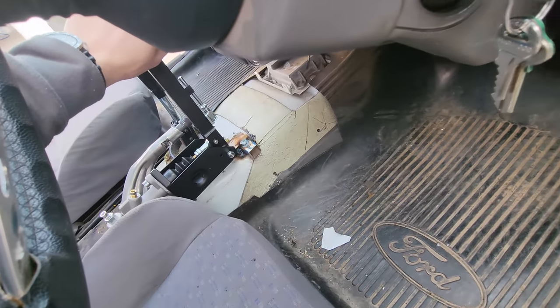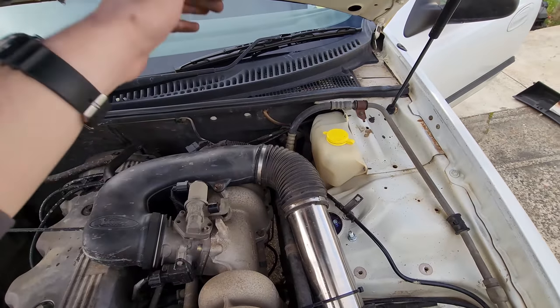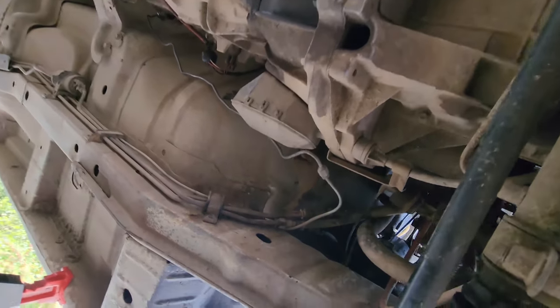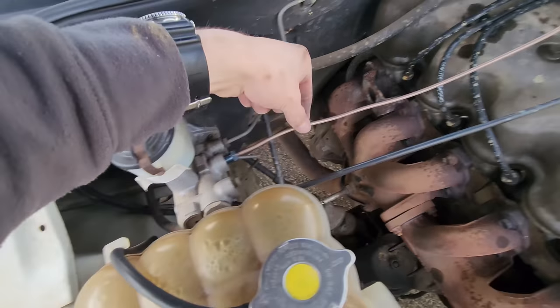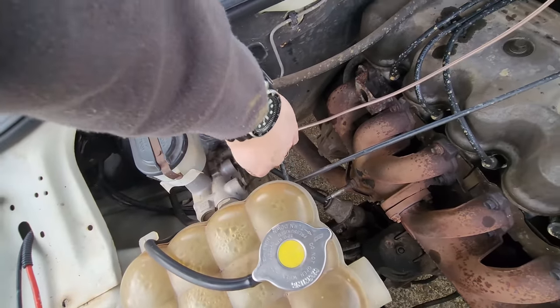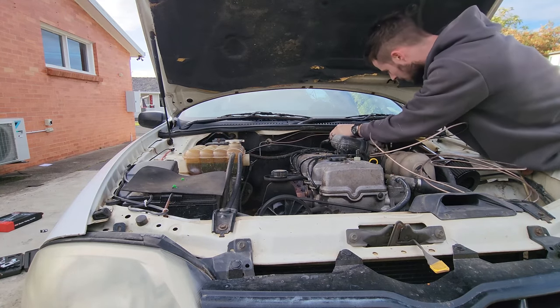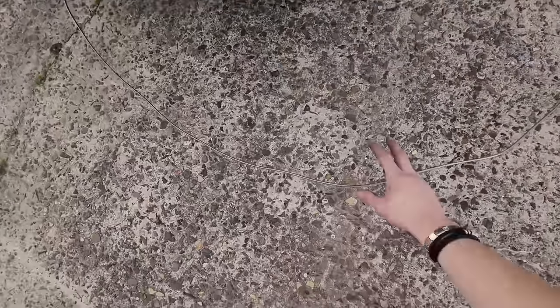The only hard thing is if you don't have a welder, get someone to weld you up a bracket for the actual hydro in the car. So let's crack on - this is so much fun, I love these sort of mods in these cars. See that line that goes over there - I just pulled it down through the engine bay, re-bent it underneath the car. You can see it snaking up there now, you can re-bend it really easily with your hands. Lines to the rear wheels - done. Now we're just making the new line from the new copper pipe that goes to the handbrake, following the same route, feeding it underneath the car to come up in the same spot as the other one.